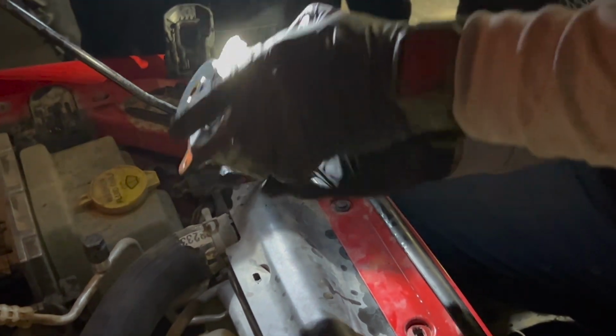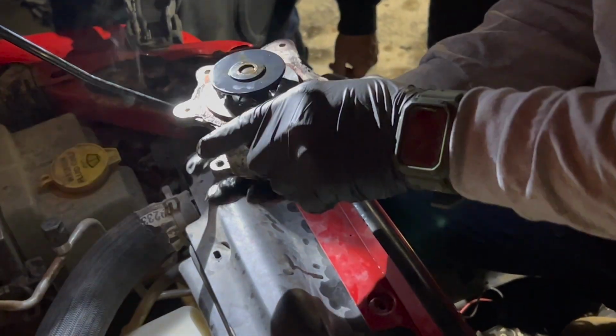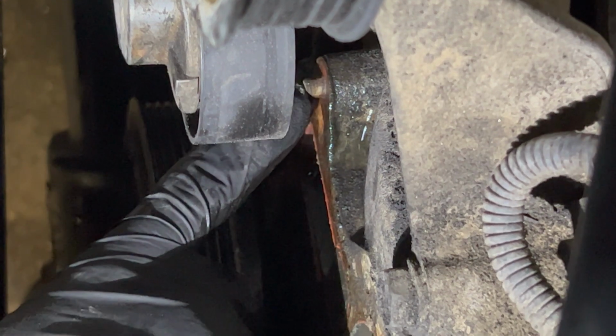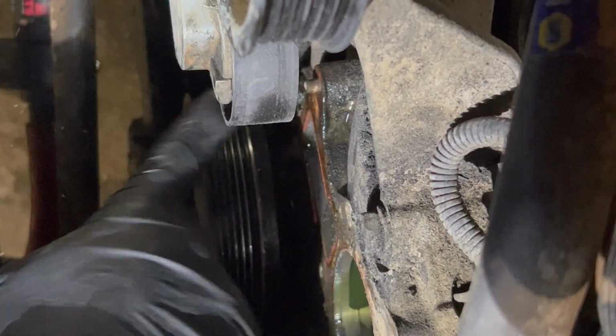So this one broke, but that's right where the water jacket is. And that thing is toast. Oh wow, it disintegrated that. It's hard to turn too. Yeah, that thing really left the chat. Let me go in and see if they got any easy outs or something. Snapped the head off this bolt, but we got lucky this time because there's a little bit sticking out. Now we're only lucky if we can get it out though.